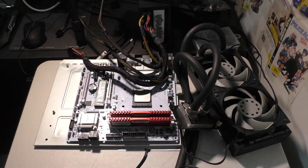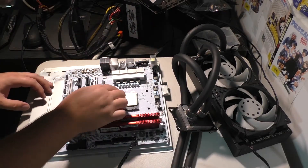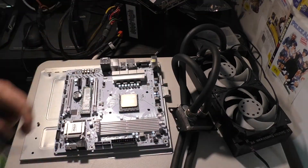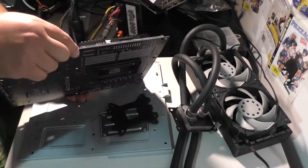That VRM upgrade was a massive difference and I was able to really push. Got to 3.8 gigahertz, no sweat. Got to 3.9 gigahertz again, no sweat, but I did have to run a 1.3875V core to stabilize it. That's where it got interesting — this is where I started to find limits to the chip.